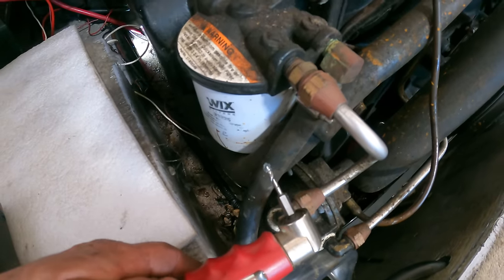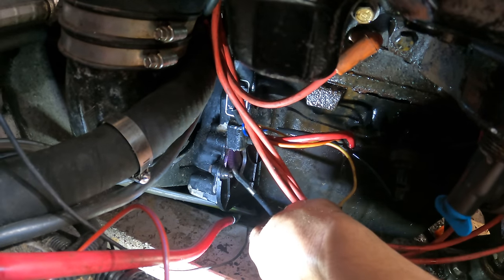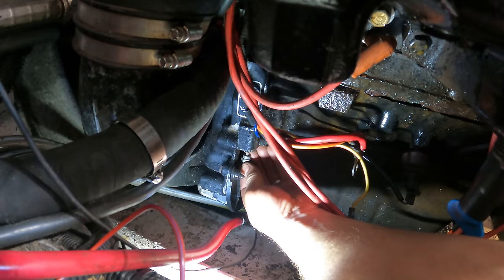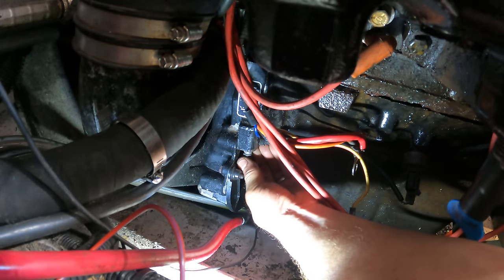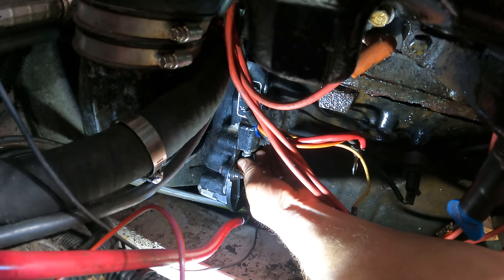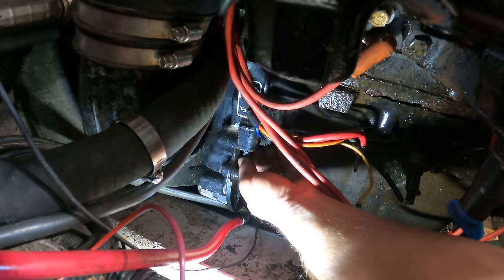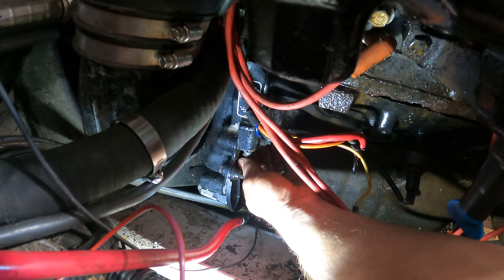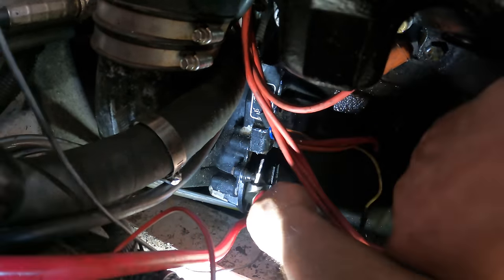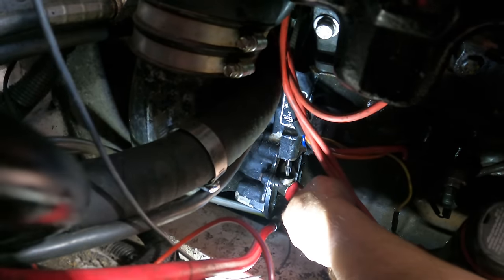So here's the update. I'm getting little bits of metal out. Get the borescope here, and you can see by some miracle I'm actually drilling it relatively up the center. Totally blind. See if I can get a bite on it with the screw extractor. I've got to go this way. I don't think I'm deep enough.